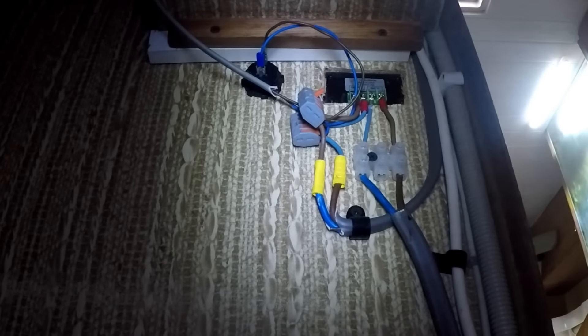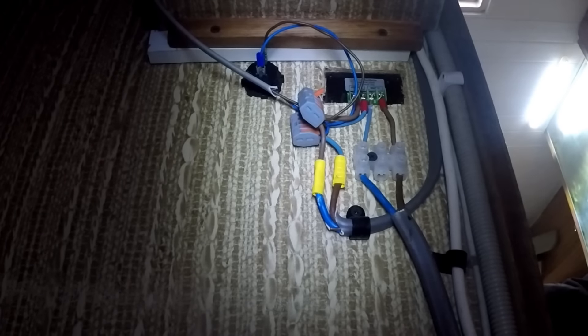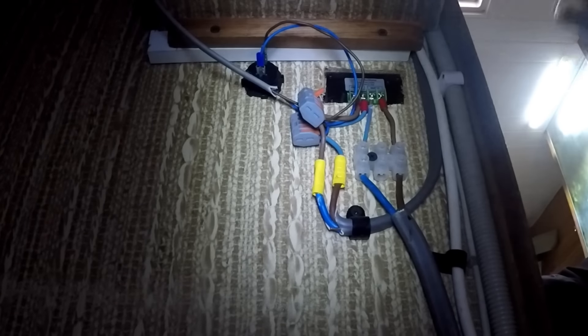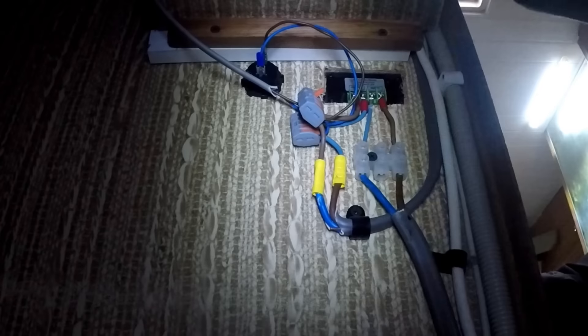What people do is wire the 12 volts all straight to their battery and think the meter is going to read it — it doesn't work like that. It's got to be read from the meter instead of from the battery. For example, I've got a 12V socket here and that's gone straight into these blocks, negative and positive. Now if I switch that on or put something on charge, it will read from the meter. Same thing with the zig box — the zig box goes straight into the device first, then the device reads from the zig box. That is the way you wire it up. Any comments, leave them below and I'll help you through it.